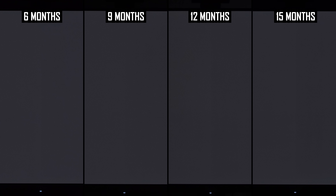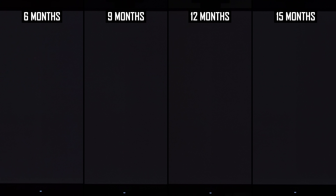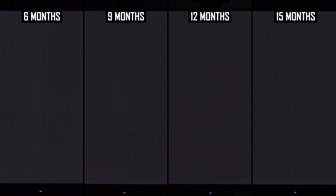I use a dark taskbar, so again this is inverse burn-in — the brighter application windows above have degraded the screen faster than the darker taskbar itself. No app icons are visible; it's just a general shadow where the taskbar is located. The third artefact is more subtle: the right side of the screen is more degraded than the left, because when I only have one app open I tend to snap it to the right side, meaning the right side more often shows brighter content. The first two artefacts have been visible from 6 months through to 15 months, slowly becoming worse, while the right-side issue became noticeable at 12 months and is now more visible at 15 months.